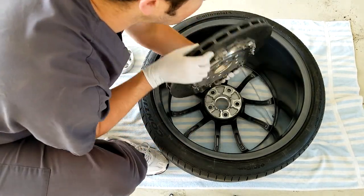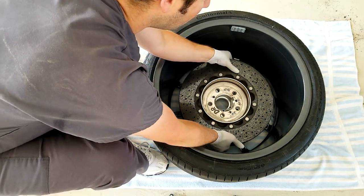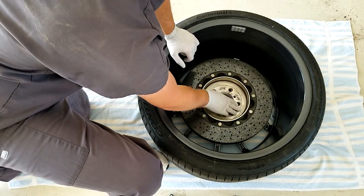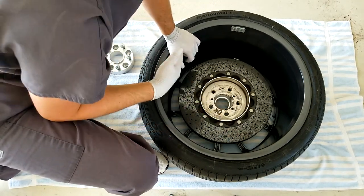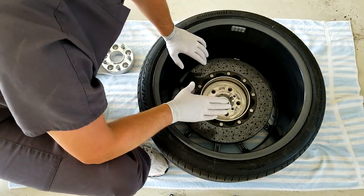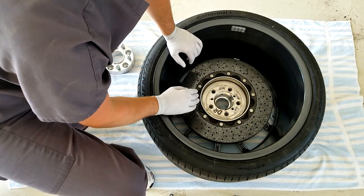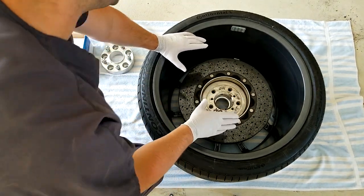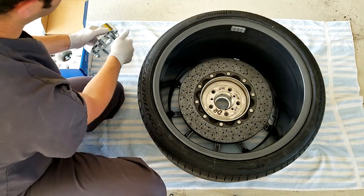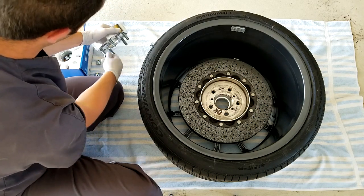You can also use the outside position — this always goes to the valve stem. When it's upside down and you can't actually see that V sign, you could make another mark on this side as well. I made a mark right here on the rotor and then extended the mark inside into the opening of the wheel. Once you do that, you always know this is the index position. The whole point is when you're looking at the rotor from the back forward, you always want to make sure you can tell exactly where they line up. Once you get these lined up, take the spacer and place it right in the middle.